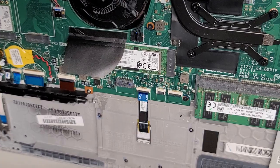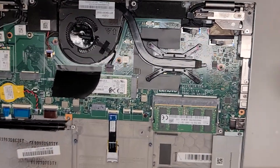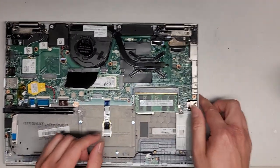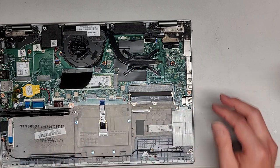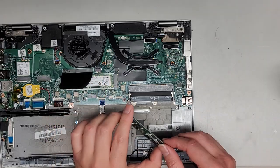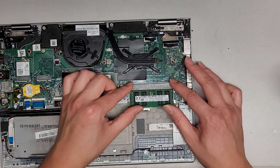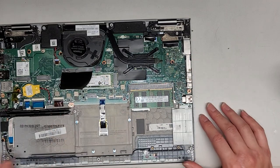You do need to clone this drive to the new one before you swap it out, or create a Windows bootable drive beforehand using another computer. Then you've got the RAM here — this comes out by pulling these two tabs to the side, it pops up slightly, and then you pull it back. Here you go — PC4-2400T. We're going to go ahead and get this back in at an angle. Make sure you push it in all the way, wiggle it up and down as you push it in, and then click it down.